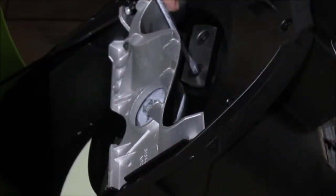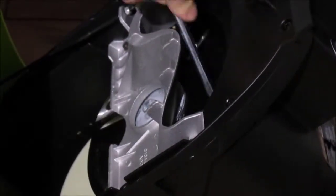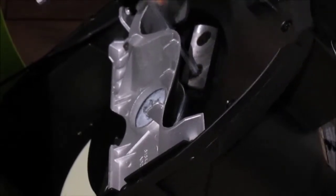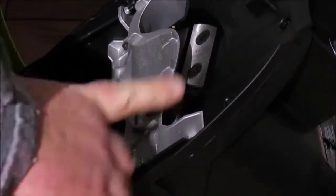Now, if you look closely, right there is one of your double blades. They include this wrench. There's your blades. You can push the motor. Since it's turned off and unplugged, I know I'm not going to hurt myself. You can take the blades out. You can easily remove the screws by reaching down in with the wrench. The blades are reversible, so if they get a little dull on one side, you can just remove them and flip them and use the other side. And the blades are replaceable, obviously, because you can take them out. You can see the metal housing in here.